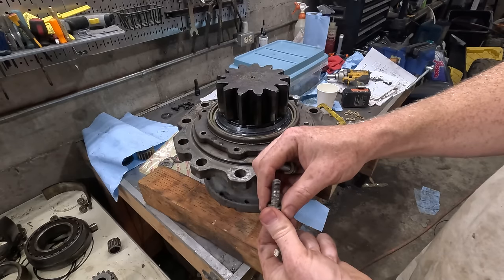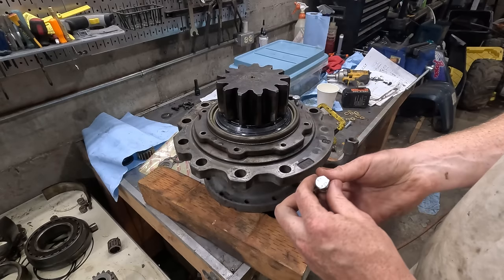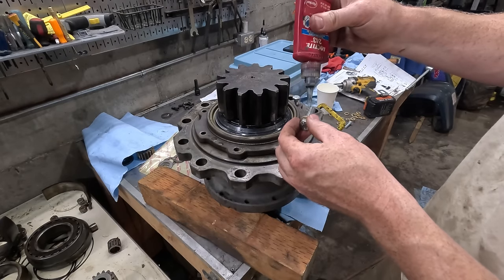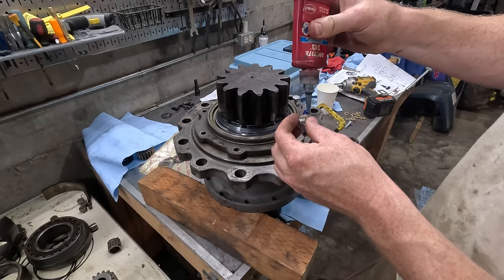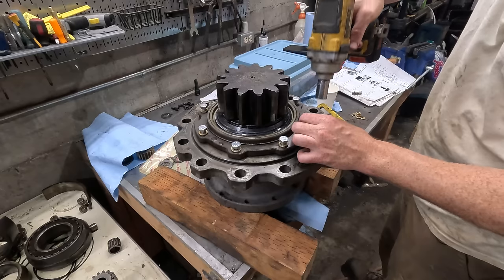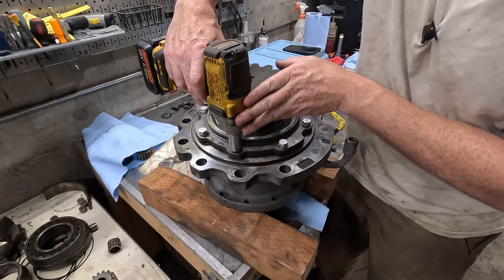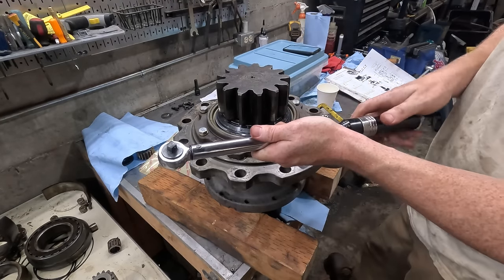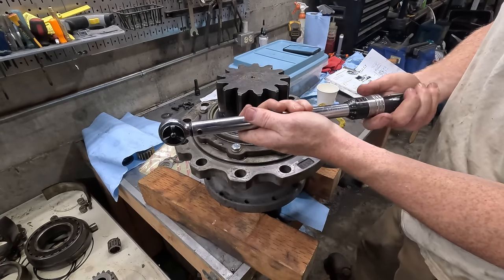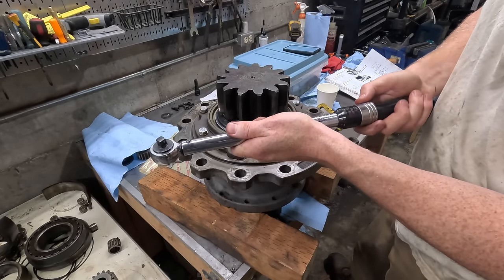So I'm just gonna go ahead, and I can't get the lock washers off either. Like they're completely stuck on here. So I'm gonna just replace it with a normal metric 8.8 and with a new lock washer and then Loctite. Torque spec's only 5 kilograms per foot, which, what is that? Oh, my bad, it was kilogram meters, which is 36 foot-pounds. I don't know why they didn't give it in Newton meters. I guess maybe if you're on a different planet, it'll torque differently.